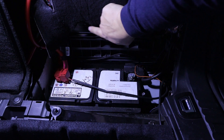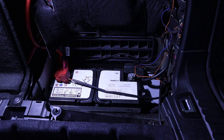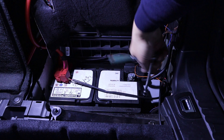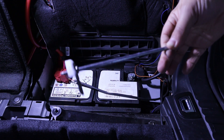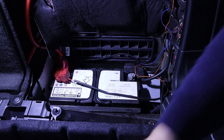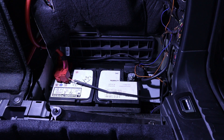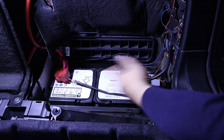I can't take it yet, but the one that was missing — it's down there. With the 10mm again, just undo this bolt here — it's the support that is holding the battery in place. Just take this support — this piece — it's the one that holds the battery to the chassis. Now we are ready to unbolt the battery terminals and simply replace it.